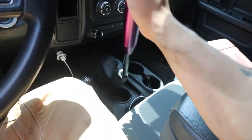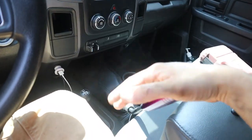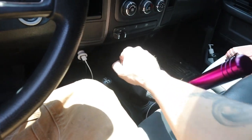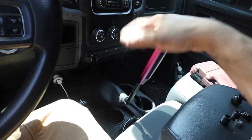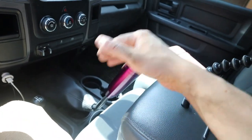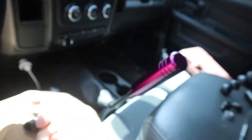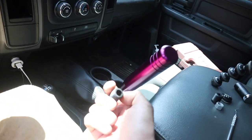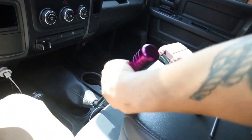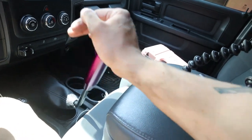Got the shift knob in and I'm already liking it a lot because it's weighted — it's so nice. It's going to be fun shifting through gears with it now. This is a lot higher than the old one, which was down low and super weird and annoying. This one is seven inches long — way better. The little plastic pieces that go inside are a bit odd; the inside's not threaded, so you put in whichever adapter is closest to yours, screw it into the knob, then screw it on and it threads itself on super tight. Just make sure not to over-tighten it so you don't strip the plastic piece.